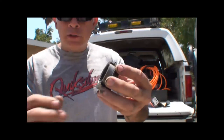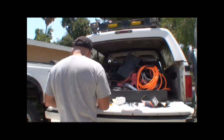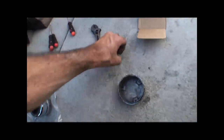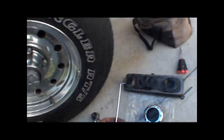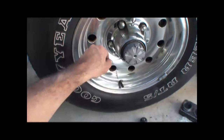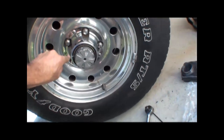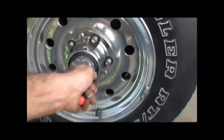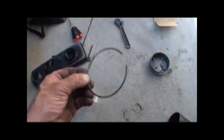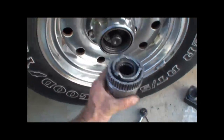My book says 160 to 205 pounds for the bearings. Now I'm taking this one apart — that slides off there. Take that out, get your little pick, and work around the inside until you find the end of the ring — there's a locking ring in there. Remove that ring because you're not going to need it; the new kit comes with one.